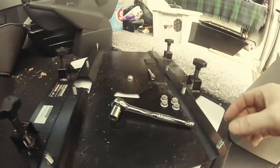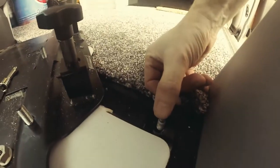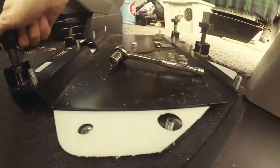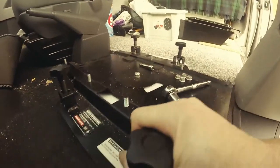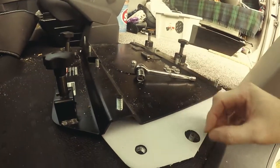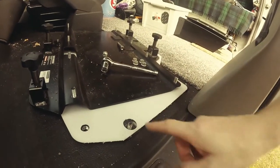Okay, just one thing to notice: you'll see that the original floor bolts have actually all been cut, and that's to allow the slider plate to move over it without being snagged. So one thing to watch is if you're putting the chair back in without the slider plate, you may need the threads to be the original length. You may need to change the floor bolts.